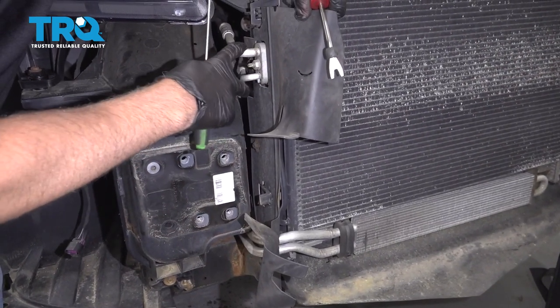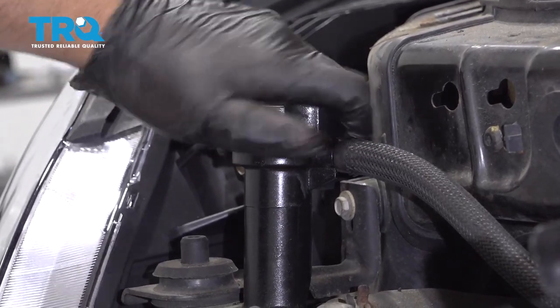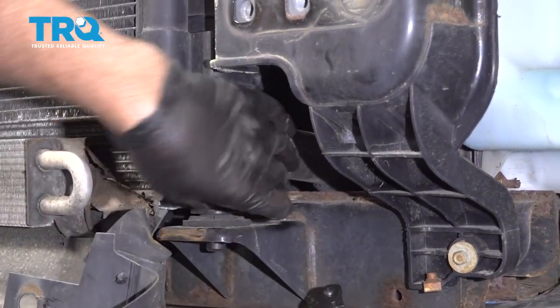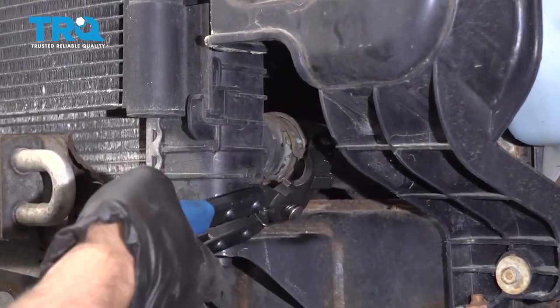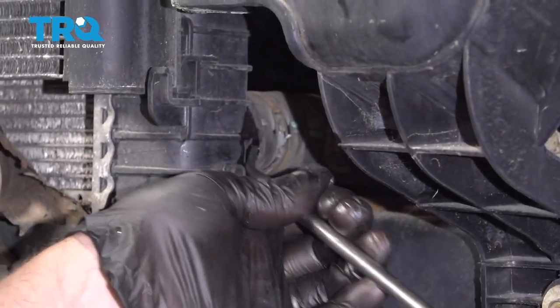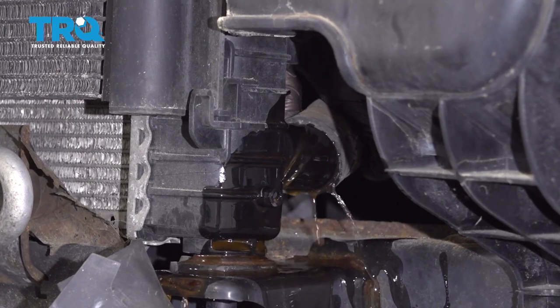Do the same on this side, but we're not gonna disconnect the AC pipes — you're just gonna have to slide this out of the way. You don't have to swing it down. Make sure the vehicle's not hot and take the radiator cap off just to relieve any pressure. This vehicle does not have a drain for the radiator, so if yours does, drain the coolant. We're just gonna take the hose off — make sure you have a drain bucket. Take some hose clamp pliers and just move the hose clamp down the hose. Now take a pick and just get underneath the hose. Some coolant's gonna come out — let's see if you can grab the hose and just slide it out slowly.